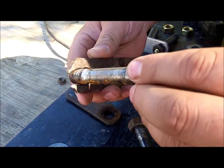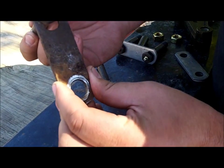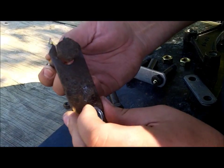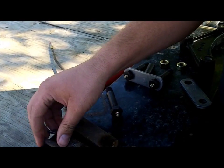If you do a little visual inspection on your trailer, the bolts are going to be here like this. You'll see a little air gap on the bottom of where it should have been in the hole. If you see that, it's obviously time for replacement.